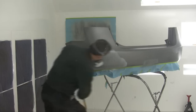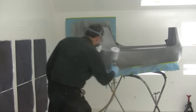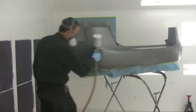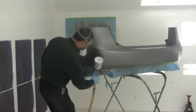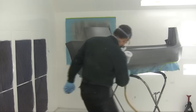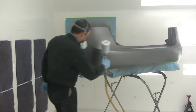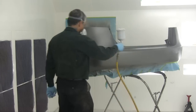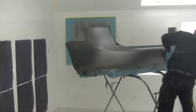The second coat is going to extend a little further out. It's important when blending paint like this to extend your coats a little wider every time and never stop in the same place, so it fools the eye, using the paint's transparency to actually blend the repair into the old color. Here the color match is very good, so I'm not going to repaint the entire bumper — I'll keep it in its original color by just blending the color in.